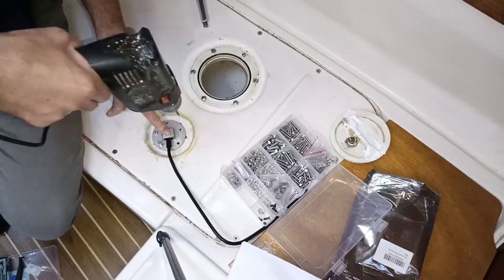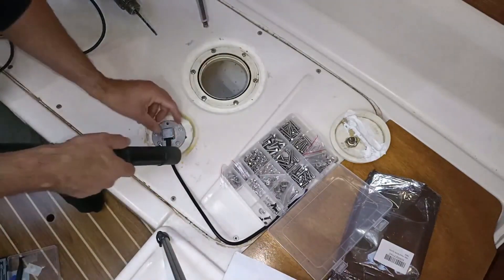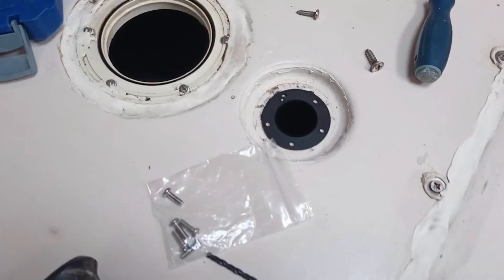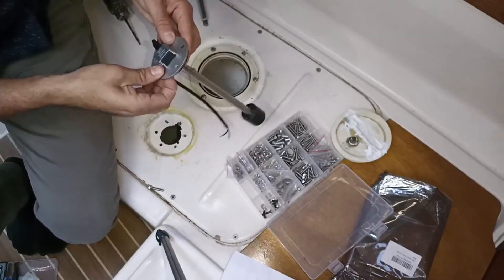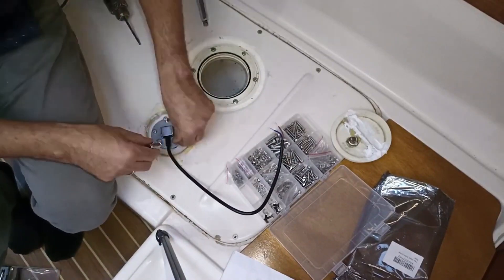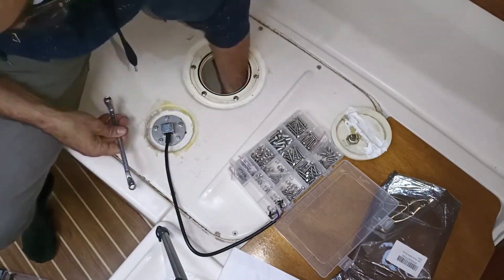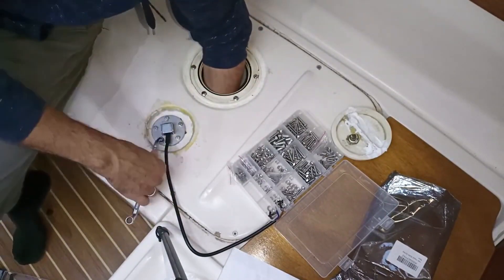When drilling the holes, be very careful. If it is a fuel tank — especially gasoline and metal — the risk is very high. You would have to empty the tank very well and ventilate it so there are no gases inside before starting work. If it is like mine, fiberglass for water, you can make the holes with more tranquility, although I recommend emptying the tank to be able to vacuum the shavings that may fall in, or put a floating container underneath so the water is not contaminated. Once the holes are made, cover the old ones with silicone, put the sensor in place and add the screws. I chose to use screw and nut because the other side is easily accessible through the cover.